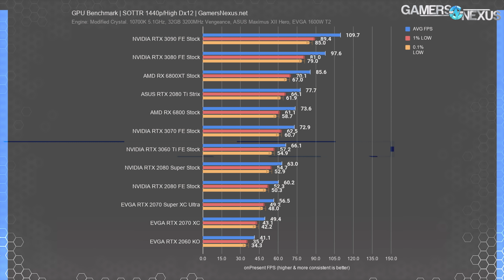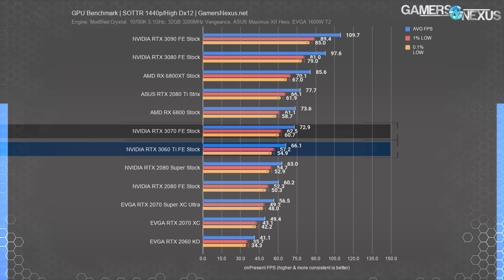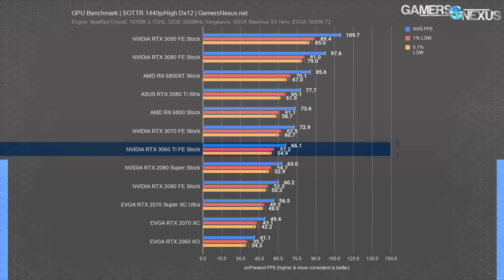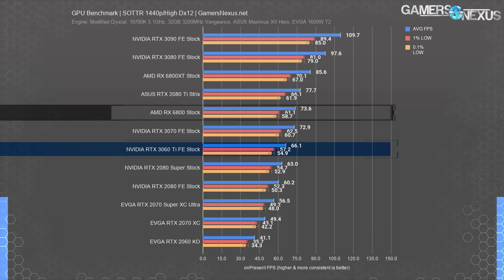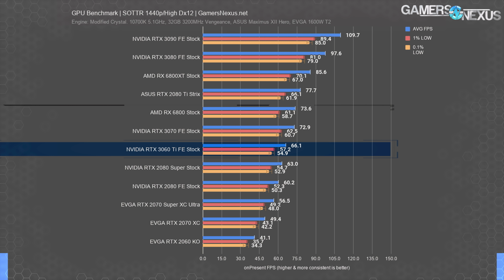Here's the 1440p chart. Higher resolutions widen the gap, but not by much. At 1440p, the 3060 Ti still averaged higher than 60 FPS, but the 3070 FE is 10% ahead. That's similar to the Tomb Raider benchmarks without RTX enabled, purely in terms of percentage scaling, and is partly thanks to the relatively lightweight RT demands of Tomb Raider. The 6800 did better relative to NVIDIA's cards here, nearly tied with the 3070 and within run-to-run variance. It's 11% beyond the 3060 Ti's result as well.